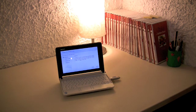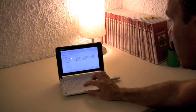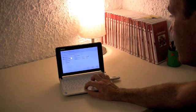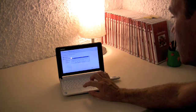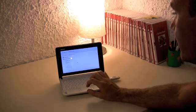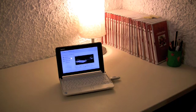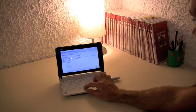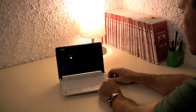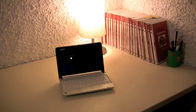Here's that familiar welcome screen — Welcome to the Acer Recovery Management for the Aspire One. All I have to do here is select the partition, 'Entire Disk' — all data on the selected partition will be overwritten. Press OK to continue and it takes care of the rest. Again this is going to take about 20 minutes. After approximately 23 minutes you get the congratulations screen: 'Your system has been restored.' Press Exit to continue, please remove this before you reboot — take the flash drive out.